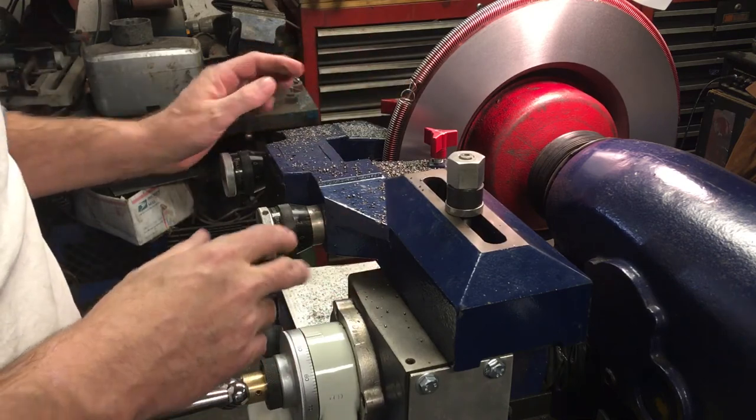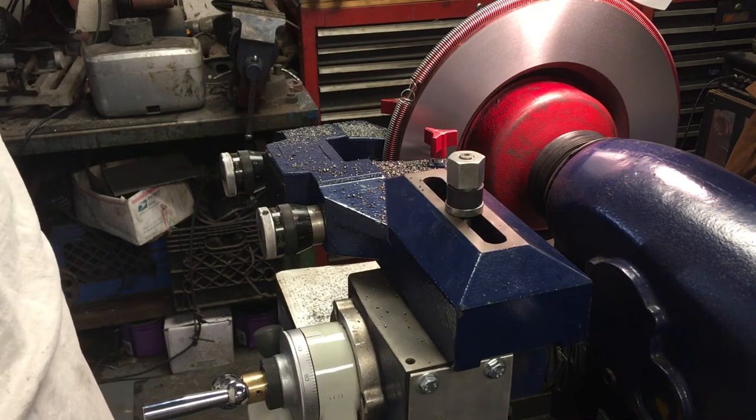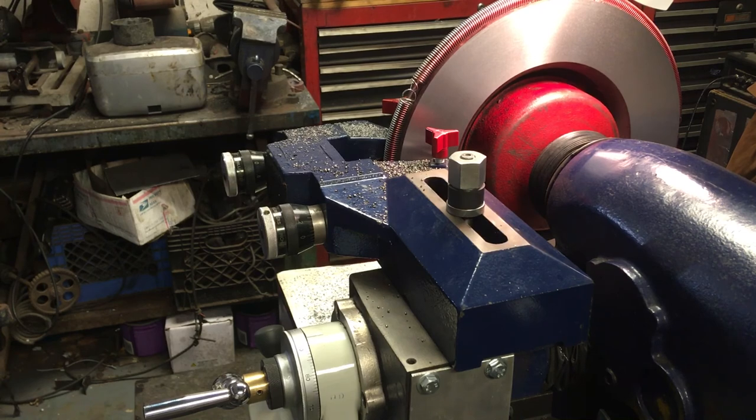You make your rough cut on the way out and cut a fine cut on the way back in. You eliminated the whole resetting step — all you had to do was reset your cut depth and go back in nice and slow. That right there is going to save everybody a minute or two on each rotor that needs to be cut twice, which most rotors do — once to make it straight and once for a nice finish pass. That's why everybody should be upgrading their old machines. We can upgrade this thing to handle some pretty impressive rotors. Going forward, the rotors aren't going to get any smaller — they're going to continue getting bigger along with vehicle performance. We could just upgrade this baby and be happy with it for another 30 or 40 years, because nobody's got anything that's going to do better than this. I haven't seen it.